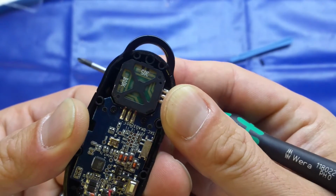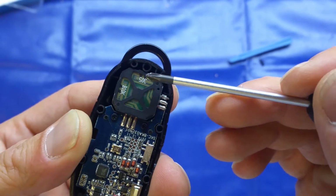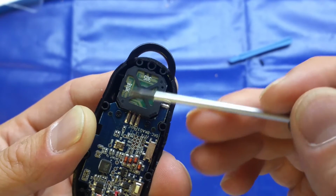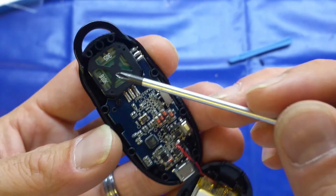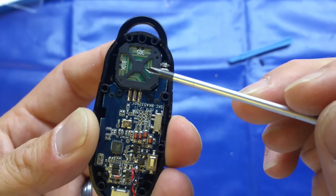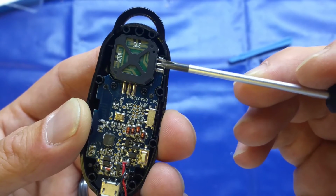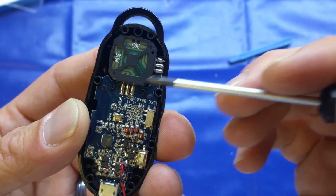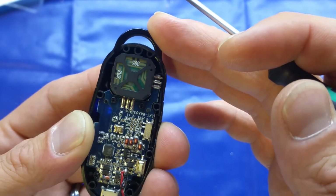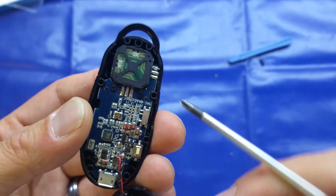We've got our joystick, and you can probably just see through the very thin PCB. There's these sweeping contacts on these tracks, and presumably there'll be some sort of carbon coating or something there. I wonder if that's just a 10k resistor on each one. Well, there's two, we can see from the pin out, two variable resistors, and it'll just work out the position of that joystick based on the resistance coming from each of those two connections.